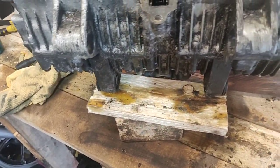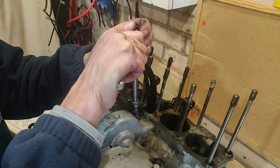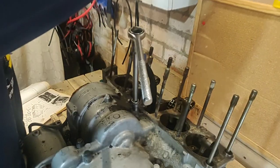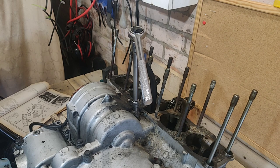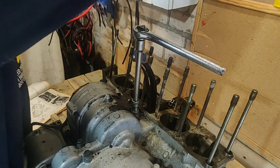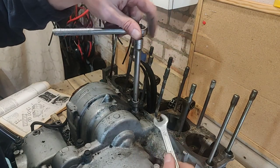Cool. Right, let's get the manual out. Right, I've had a bit of a tidy up on the bench. I did find an answer to a question last night as I was flipping through the book on how to get rid of this blade, and it does say to remove it before. Let me slack it off first. This has been a vexing issue throughout. Camshaft tensioner should be removed. Tensioner blade can be removed after the stop bolt and lock nut have been slackened off. So I'm trying to slack it off. So it says slack it off, not take it off.